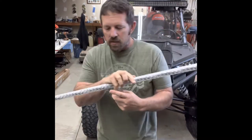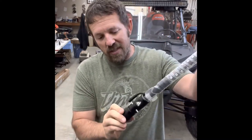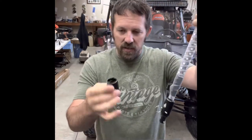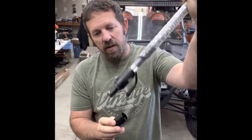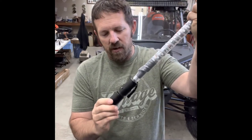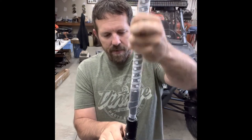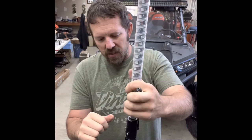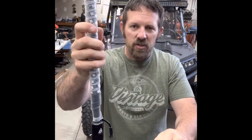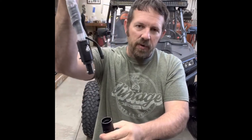I think they're a pretty cool design. One thing I like about them is this quick disconnect feature here. This bottom piece stays mounted on the machine. It's got those two pins — they slide down in there. There's a spring in there that keeps tension on it. So when you're ready to disconnect the whips before you go into your trailer, or if you need to take the whips off for any reason, disconnect the wire harness, just press down and it releases.